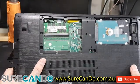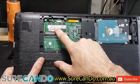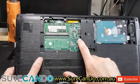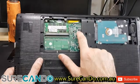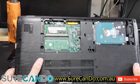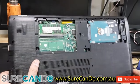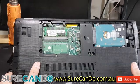So that uses an 8 gig DDR4 2133P, and I'm not sure if it's low voltage. That's most likely the BIOS chip. That's the ENE chip. Nice, it's very nice when they make it convenient. You can see the coil, MOSFET, etc. I'm assuming these pins have something to do with shorting or resetting the BIOS.